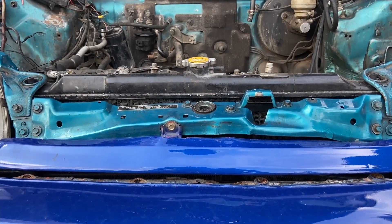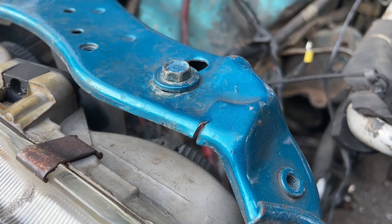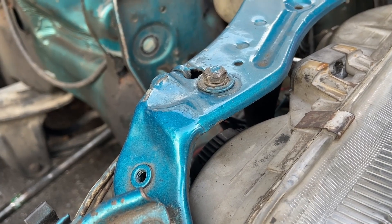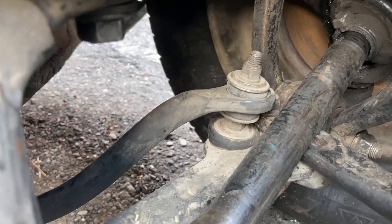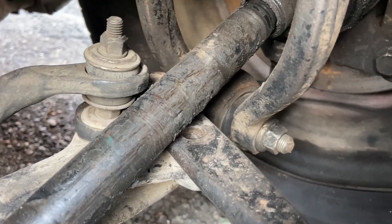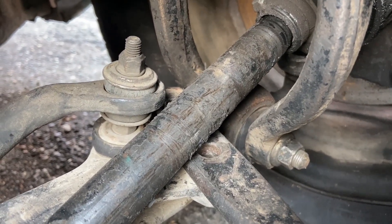This kind of bugged me a little bit — I realized that the t-bar is being pushed up and I'm not quite sure what's causing that. I don't know if that is what's causing the edges here to kind of crack and twist, so I may need to either replace that t-bar or just adjust it. The traction bar is also missing a bolt, and these bushings are going to need to be changed — they are 30-year-old bushings so those need to be changed regardless.